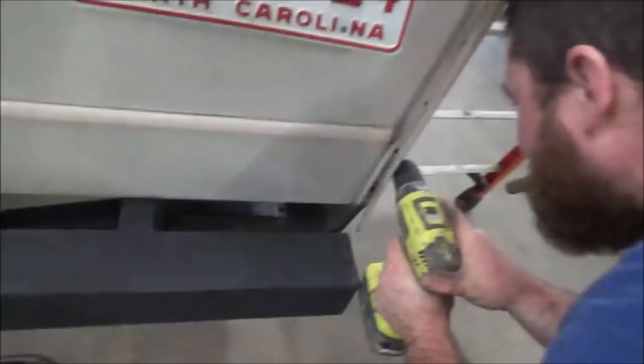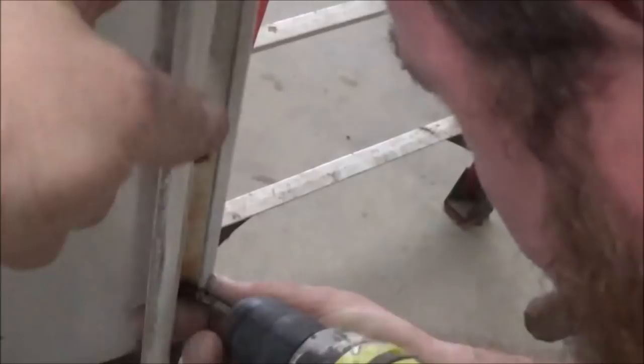Oh, this is real. I gotta zoom up. You can even see all the rust on the corner mold, is what it's called. Look at these ones here. See? So that's how you would check it. And then if it's good, you just put it back. And check a few more. You can check all the corner molds, like this one on the other side, on the front. Just randomly check, because that's where you're going to get a lot of your leaks, right off the rip. So, let's see if I can get up on the top here and show you this.